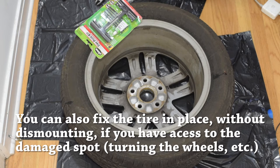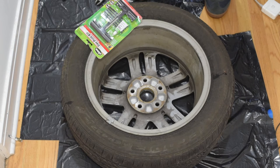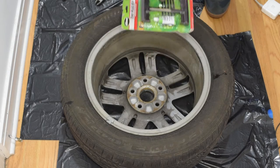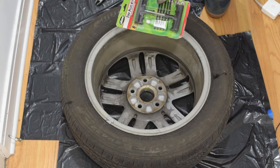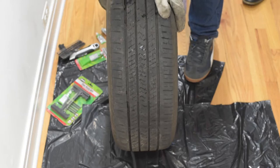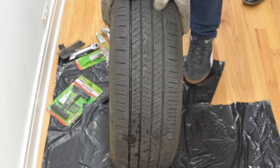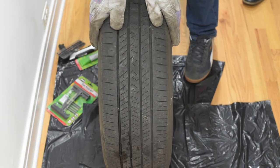Basically you have to dismount the tire and once you do that you need to check the tire and find the actual spot. You will also need one of these sets — a tire plug kit. I got this at Walmart for like 10 bucks and I always have it in my car. So the hole is pretty big, you can usually hear it hissing. Sometimes you can see the head of the metal object, or if it's a nail you'll see the head of the nail.